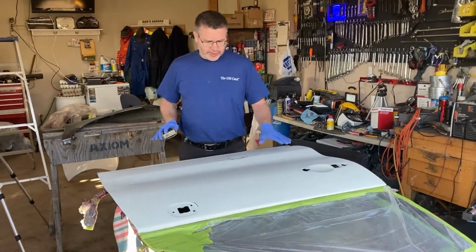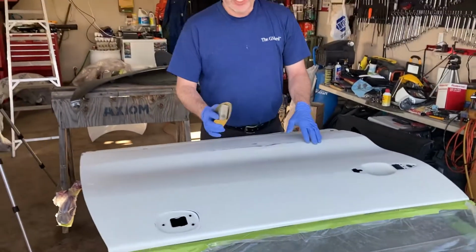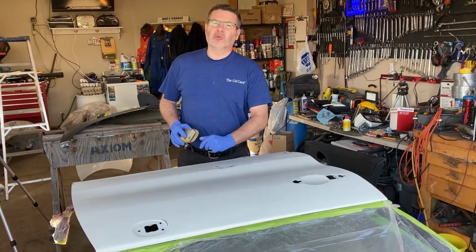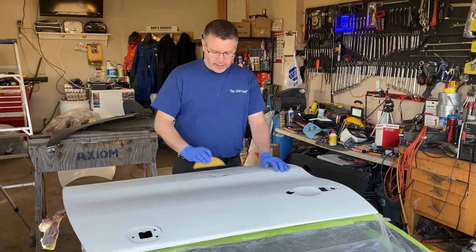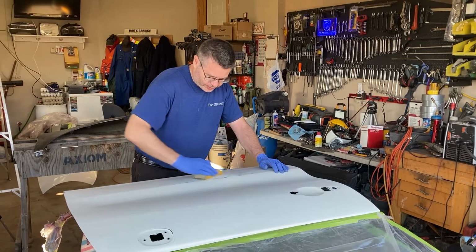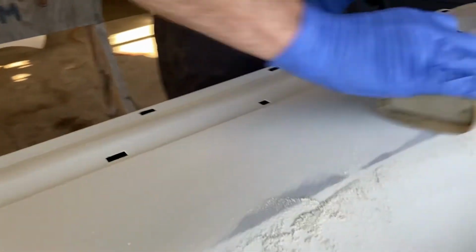Okay, well, first of all, we've sanded this down, got the gloss off of most of it. I left a little bit here so you can see the gloss compared to how it's flat now. Don't know how well that's going to show up in the light, but you get an idea. Any of the dents we're doing, I just sanded with a 320 grit to scratch it up a bit and a Scotch-Brite pad. But if we're going to be doing Bondo work, then we want to rough it up with like an 80 grit, give it some good teeth to grab onto. So that's what I'm going to do now. I have my soft pad here, so I'm just going to do an X pattern. I'm just going to get in here where we want to work it, and give the Bondo something good to bite onto.